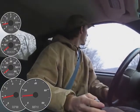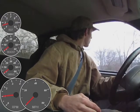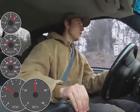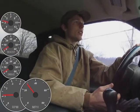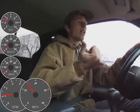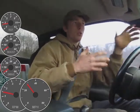Basically coming to a rolling stop. Here we go. I'm going to do that to calibrate the gauges. All right, that was missed. That may have been 60 - pretty miserable launch. Still got to get used to the G56 and the clutch, but the information's all there. You can still look at the boost and see if we watch for any overshooting. Next off, the 1,500 RPM pull - basically we're going to go below 1,500 and creep up to 1,500. That way we're still accelerating slightly, which helps get rid of the slack in the driveline.